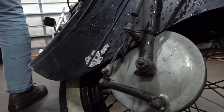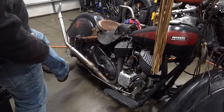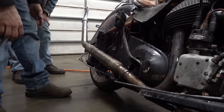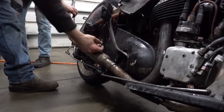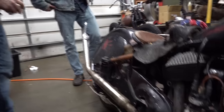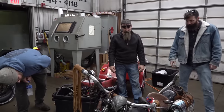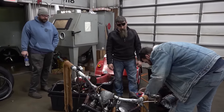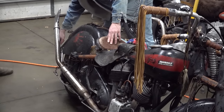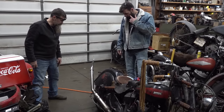Well, I didn't feel any of it because I had this seat - it was extremely painful. This is kind of a stock header, and then this looks like it was twisted - it is twisted. So it would come down here, and the way they've mounted it, they probably just did that to be hot-rod kids with a kick-up pipe. They welded a bung on there so the pipe would twist - the pipe usually hugs back here a little bit. They put a fishtail on it, and the bung holds it in a kick-up position. Normally there's a P-clamp that would bolt to the lower section and hold it down.